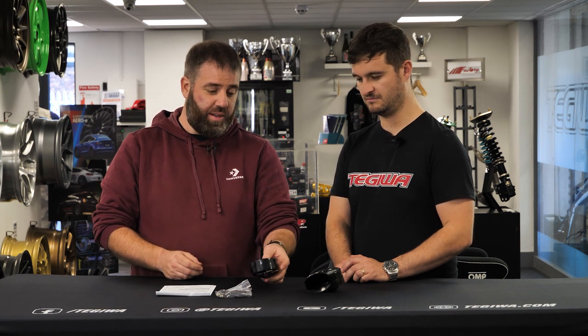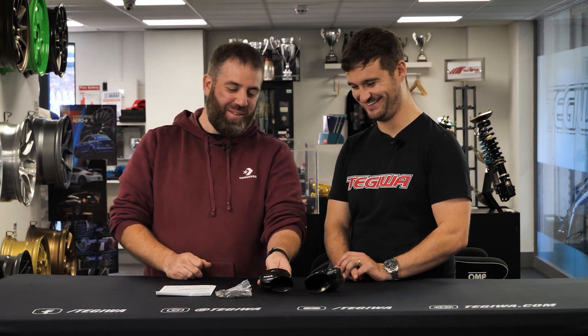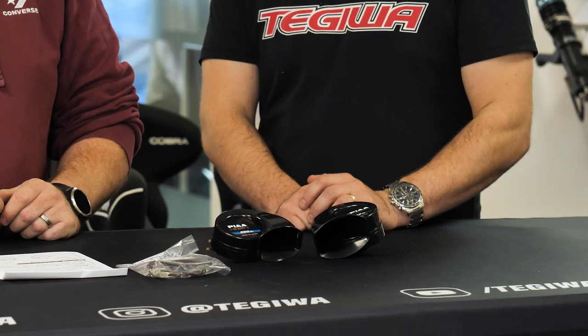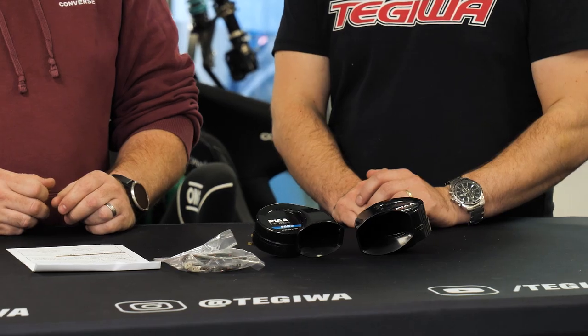The negative will just go to a ground. Horns generally just have one positive wire going to them. If they have two, you just need to follow your manufacturer's wiring loom guide. It's not rocket science — just positive and negative and that's it, and it'll work. Whereabouts do they fit? If you're a Subaru owner you can see them, but not on your Yaris. I'm going to fit them a bit tidier — tucked away behind the bumper. It depends where your standard horn is; sometimes they're visible in front of the radiator, sometimes they're hidden away.